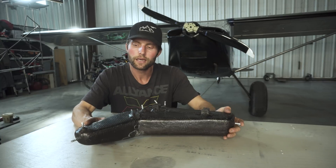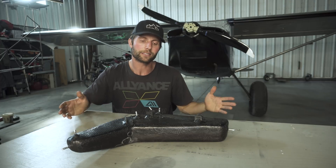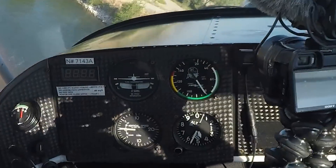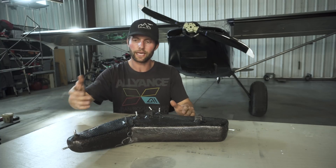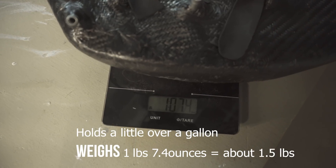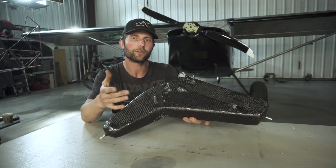Some of you guys might be thinking, why do you need a header tank? You've got your two wing tanks, and from those wing tanks it either joins together to one line, which is how the Capella is. But it's nice having a header tank. When you are getting low on fuel and you're flying uncoordinated — meaning you're not keeping the ball in the center — all the gas is going to one side and you could run out of fuel. So having a header tank prevents that. It leaves you a little room. Also, I'm going to start competing and I can just run completely on the header tank and drain out most of the fuel in my wing tanks. I have a sight tube here so I can visually see how much fuel I have left.